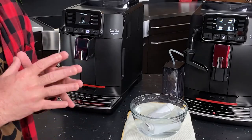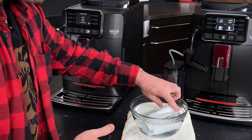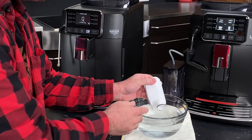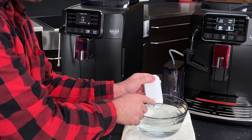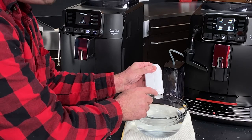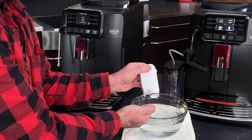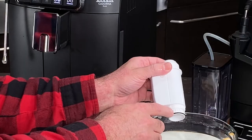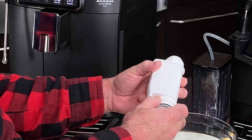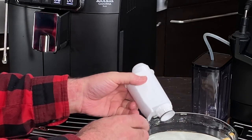It's a two-minute process to get this done. Now let's take a look at how we're going to activate our Mavia water filter. Before we install it in the machine, there's something we're going to want to do, which is to set the hardness on the filter itself. There are three settings: A, B, and C — B is where it defaults. These correspond to the results of our water hardness test strip. A is going to be 1 and 2, B will be 3, and C will be 4.